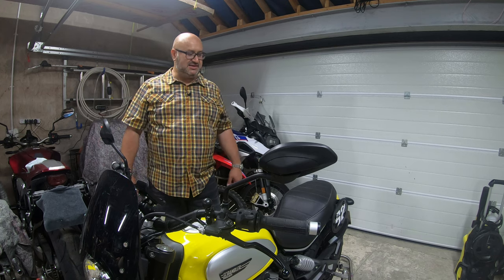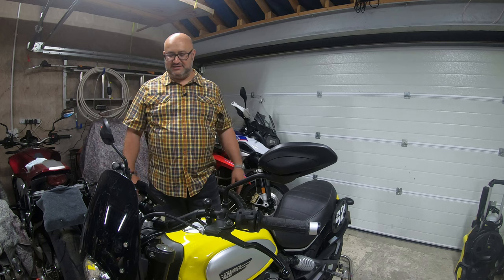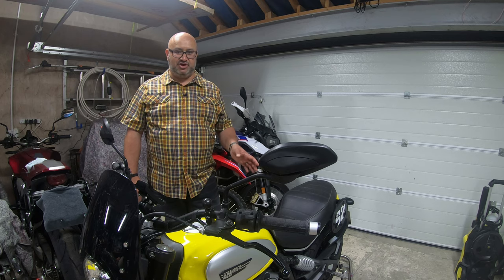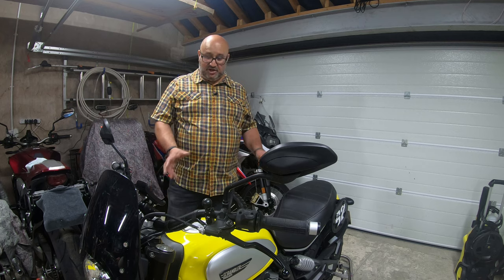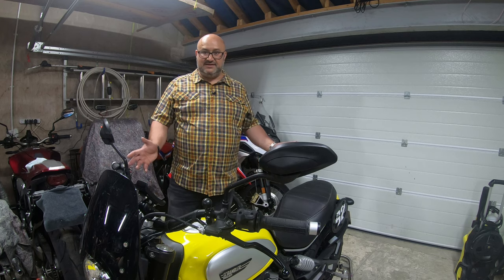As mentioned in my news update, I'm going to be doing a few videos on lowering bikes — both my CRF300 Rally and this Ducati Scrambler. The suspension work is part of that. The rear shock has been set up for her weight with luggage, so I suspect when I sit on it it'll drop down a lot more. For the front end, I'm going to lift the fork tubes in the triple clamp by about 10mm, which is a popular mod to drop the front a little. Between that and the preload backed off at the back, we're hoping this becomes a lower bike that someone around 5'2"–5'3" could get on and feel really comfortable. Please like and subscribe and I'll see you next time.